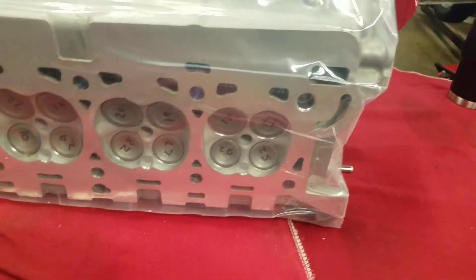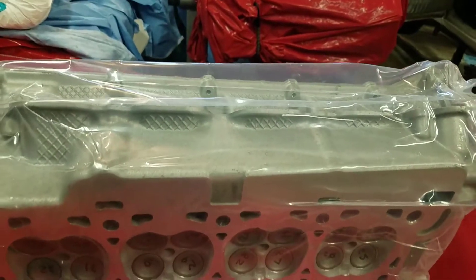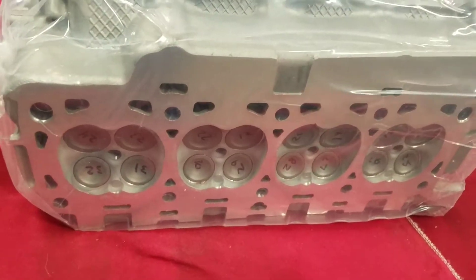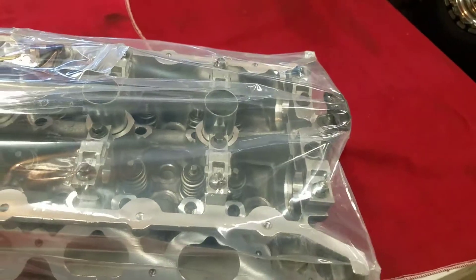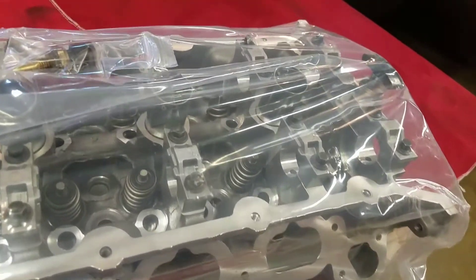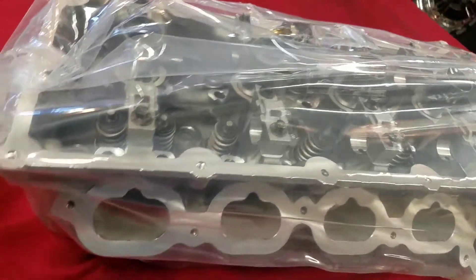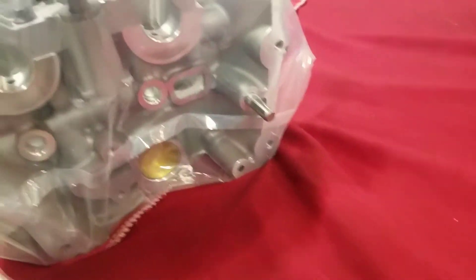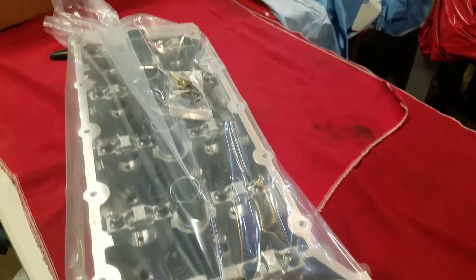I don't want to unbag them yet, but as you can see they've numbered them all — so when they do the valve jobs they keep each valve matched to its cylinder so that valve fits that seat perfectly. What we did on these heads: stock valves, but with their Stage 3 valve spring — we'd go Stage 4 but at my current power and boost level these are probably good. Chrome moly retainers, Stage 3 springs, bronze guides, and a complete valve job. Also the brass freeze plugs, because I blew the freeze plugs when I blew the head gasket. Now we're just waiting on head gaskets to start assembling.